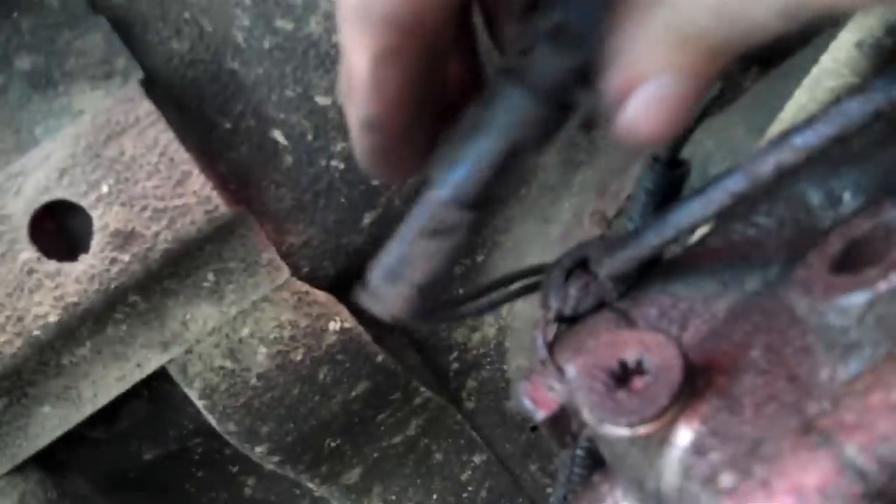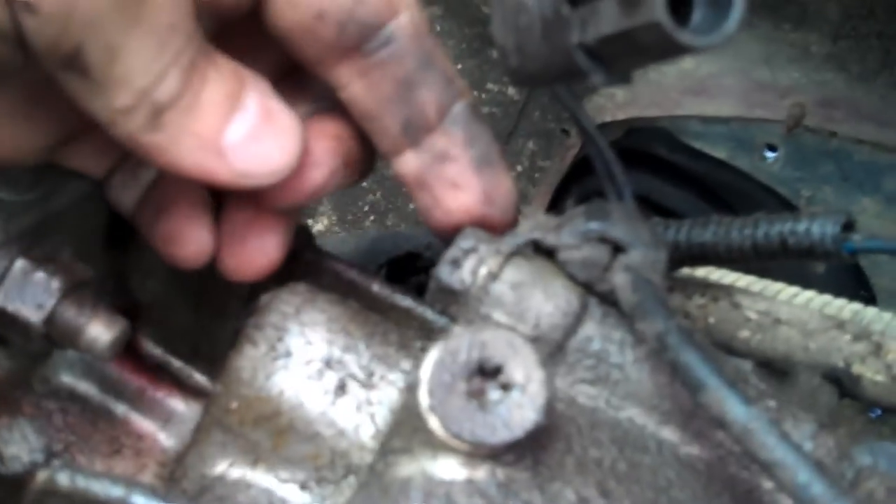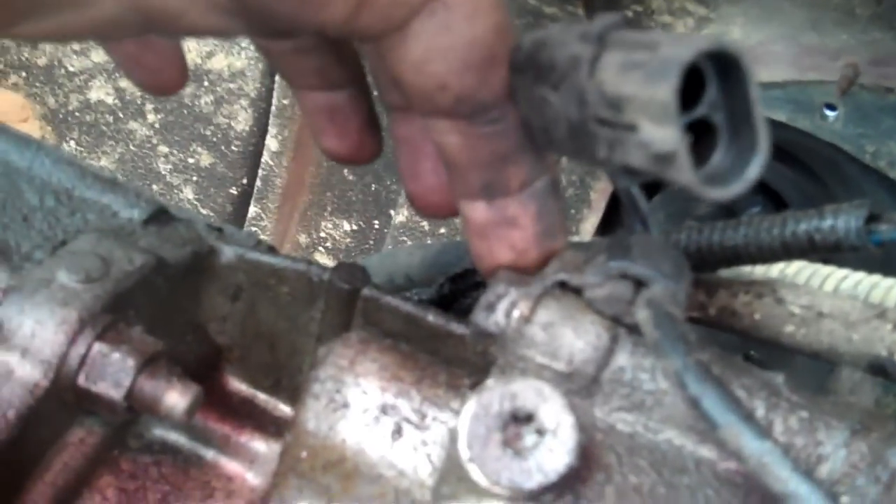Also got a plug over here — be sure you get that plug too. See the perimeter of your transfer case around there. Notice the plug up here — that's your neutral safety switch. It bolts into the back of the adapter that goes from the transfer case to the transmission. Unplug it there and you should be free and clear.